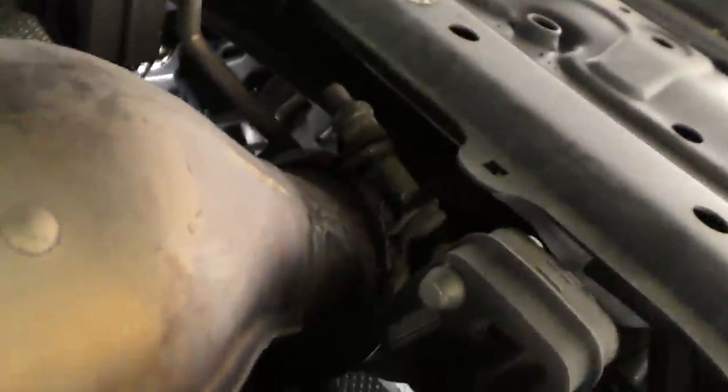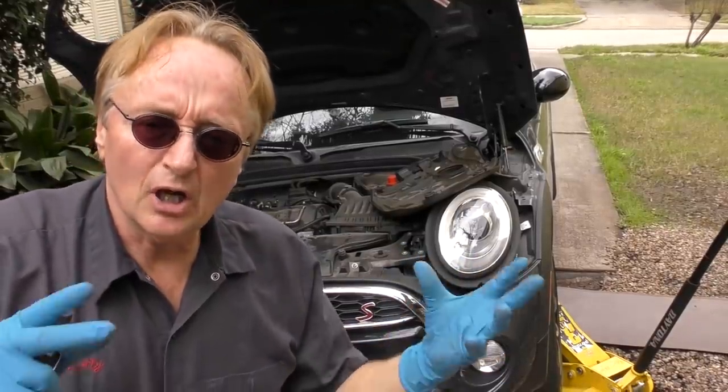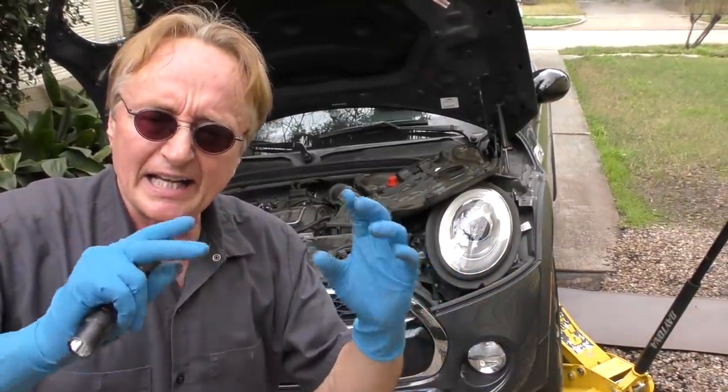This car doesn't have that many miles on it — you can see the exhaust system has a lot of stainless in it. There's nothing leaking yet. So we're following the whole way up past the cat, up to the front, and there's no smoke coming out anywhere. So in this case, there are no obviously big static leaks.